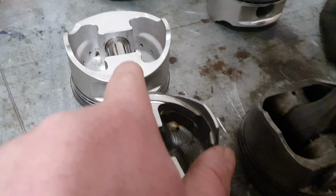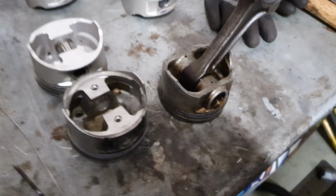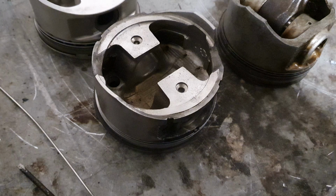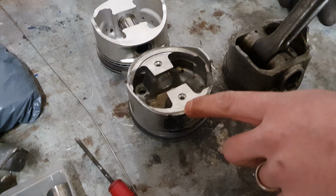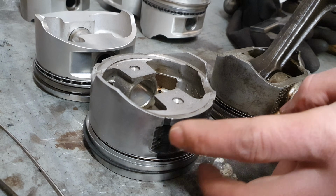That and that have got far more strength than a stock SR piston. But the interesting point is that, obviously, the forged one you'd expect to have that, but even the 300Z has got so much more R&D and engineering put into it, really. The one thing that's interesting as well is that it's not only strength, but that's also another land for the piston to run on.